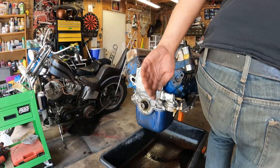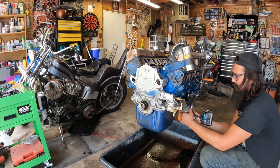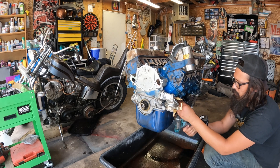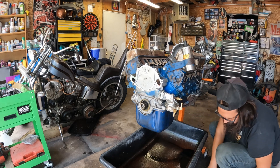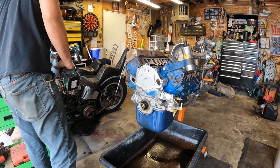Since we're pulling the pan, I gotta pull the motor mounts — not technically required, but one of these bends sticks just past it, so I'd rather not have issues with that. For two quick bolts it's not that big of a deal. Yank the fuel pump off of this as well while we're at it.